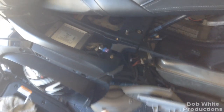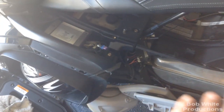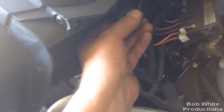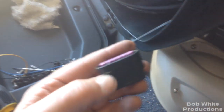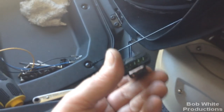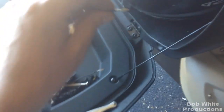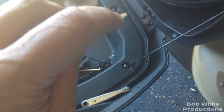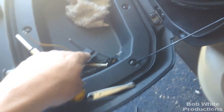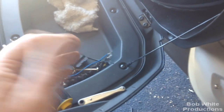To hook up the GPS to the audio system — the way BRP does it — there's a connector mounted right under here. If you don't have the harness, you'll have a dead plug keeping it watertight with rubber plugs. This connector will let me make a harness to run up to my GPS. These are standard power supply pins available at any electronics store — they have a little leaf spring for locking and they work perfectly in that connector.